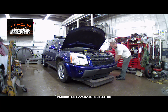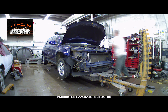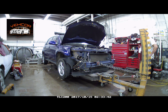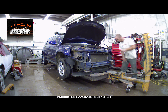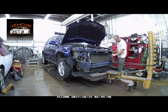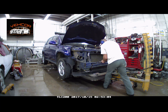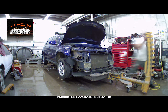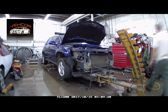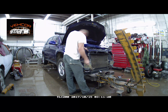Then we're going to do the front end — take it all apart and pull the bumper reinforcement out a little bit. There are a couple brackets at the end of the frame rails that were bent in from the reinforcement, so I'm just hammering those straight. Just like the rear, the bolt holes didn't line up on the outside, so instead of pulling this one I just cut it out so I could get access to those holes. I go a little bit further on the bracket, check our fit — looks good.